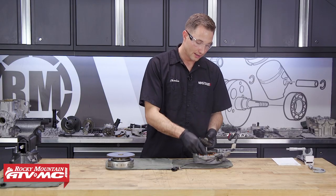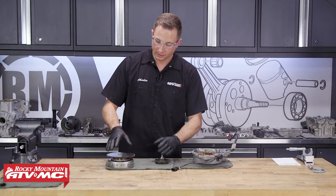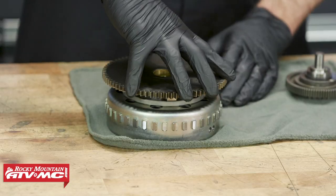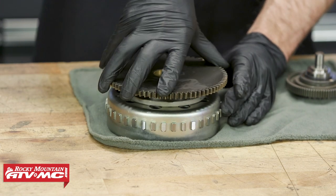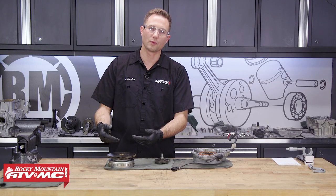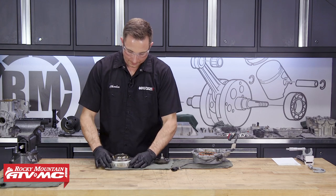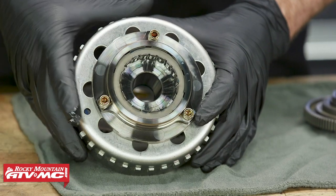You're also gonna want to check the bearing surfaces where the shaft rides — right here in the stator cover, make sure that's in good condition. If there's a ton of free play in there, you know it's bad, and there's also the other side that goes on the engine case. Moving on to the flywheel — it has the starter clutch on the back side. We're gonna check this operation: rotate it clockwise and it should rotate freely, but as soon as you try to go backwards, it needs to lock up. If you can spin it backwards, that one-way clutch is bad and needs to be replaced — it's just a bunch of roller bearings in there that jam up when you try to go backwards.